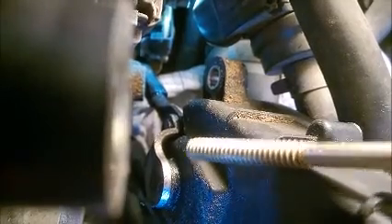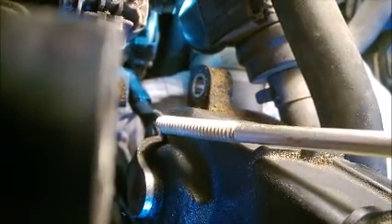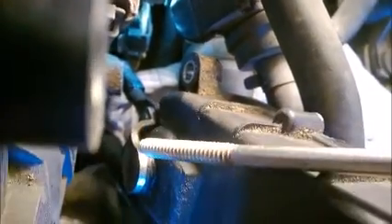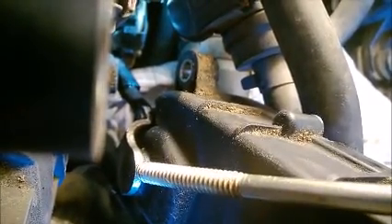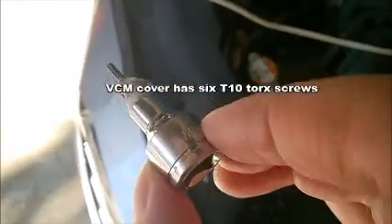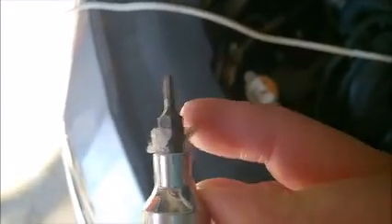This pivot is metal on metal - I suggest you put directly one droplet of penetrating oil, then put a droplet of engine oil to prevent rusting and it getting harder to move. For the plastic knuckle, maybe put a very little penetrating oil - penetrating oil is better because you don't want to get oil inside the unit. Also, don't spray anything on the top here because it will get on the plastic gears. To access the cover, there are six tiny T10 torx screws which I put on a quarter-inch drive socket - just jam it so you don't drop them.